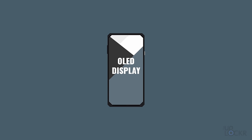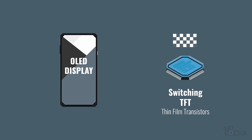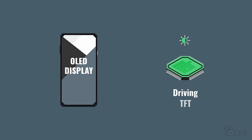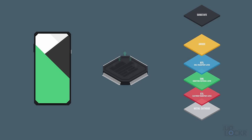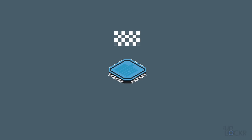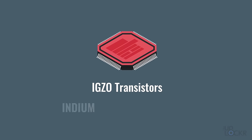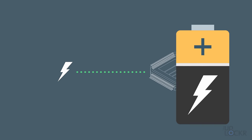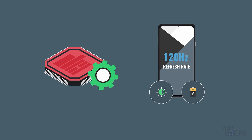The way this works, for those that are curious, is it's technically a hybrid of different transistors to try to get the best of both worlds. For an OLED display, we have two types of transistors: one to control the turning of the pixels on and off, called the switching TFTs or thin film transistors, and the other to maintain brightness, called the driving TFTs. With an LTPO screen, LTPS transistors — which can fire rapidly based on inherent properties of the material being used, sort of necessary for those refresh rates — are used for the switching TFTs like normal. But the driving TFTs use IGZO transistors, indium gallium zinc oxide, which, because of their inherent properties and the fact that they are transparent, require less power from the backlight to power them and are more power efficient. This combination plus optimized software allows the changing in the refresh rates while keeping brightness high and power consumption low.